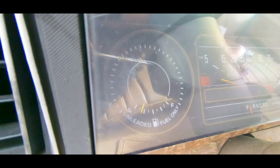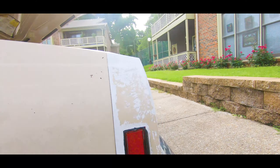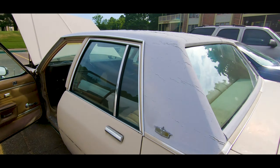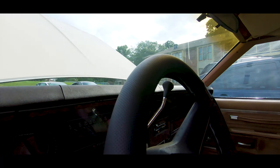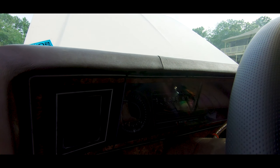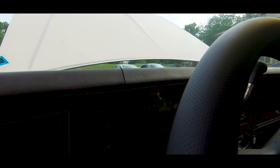One more thing too — in the first video I showed y'all a tour around, I probably showed y'all my gas meter. So you can see right now my gas meter is working. Prior mistake honestly — if you look right there, far down you'll see a little pink line. That pink and white line right there, make sure that's connected — that's the ground wire to your gas tank. Get that connected and it's gonna work. If it's still not working, it's probably gonna be a fuel sending unit. But after I connected it, the gas meter worked.